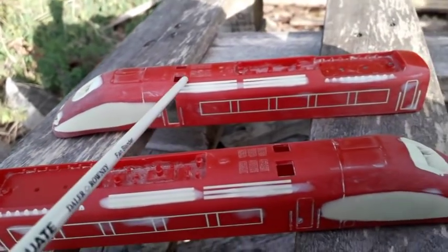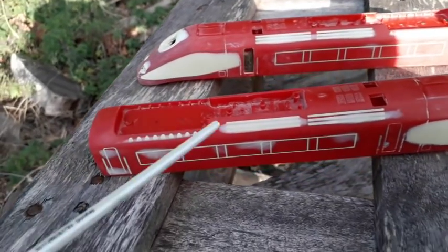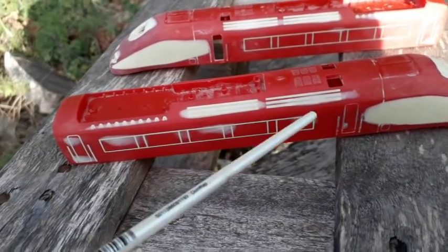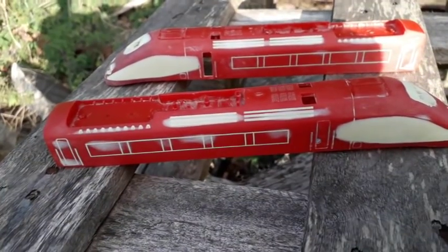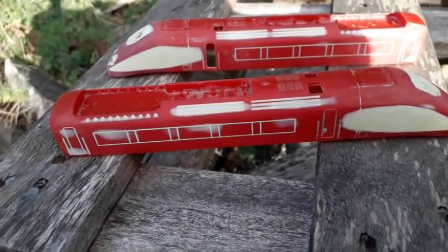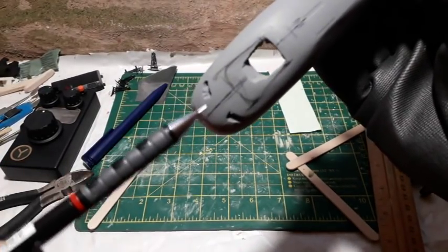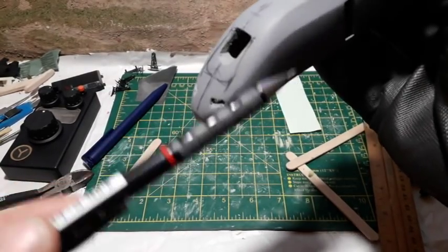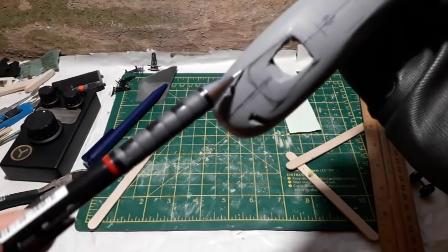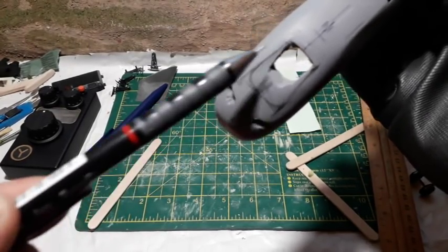From the door back there's no more I can do with regards to filler. I'm going to spray the whole thing — this and this as well — just so I can see what I've got, because at the moment with all the red and white it's hard to tell what it's going to look like. I've just marked out some positions on here to find the center. Where I've been cutting the windscreen it's difficult to know the center, so I've had to measure that carefully. This is the new shape for the windscreen section.